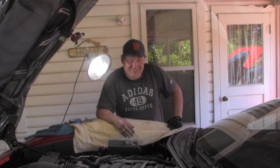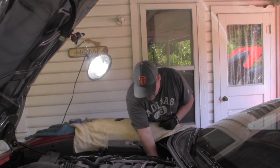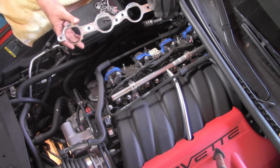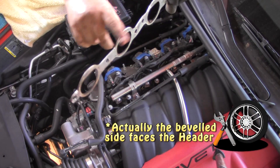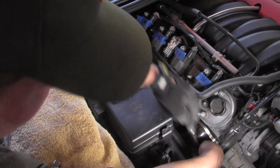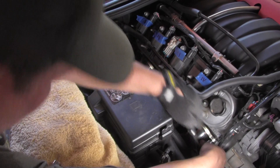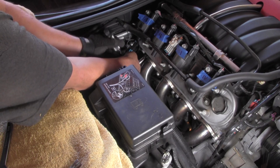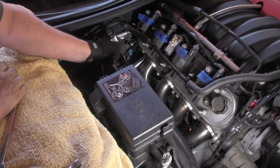What kind of sucks about this is I've got to put it all back together to know if it worked. So I'll plug in the sensor, put the gasket back on, and hook the header up. I'm going to go underneath and reattach that. It's a hundred and three or four degrees today and I'm trying to get all this done in just a couple hours. The beveled side of the gasket faces the block. I've got everything on the underside in place and ready to go, so now it's just about tightening these guys up, then I'll come back and hit it with the torque wrench. That's 10 pounds.